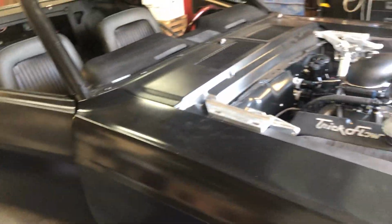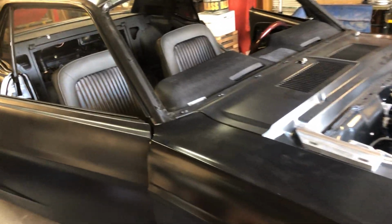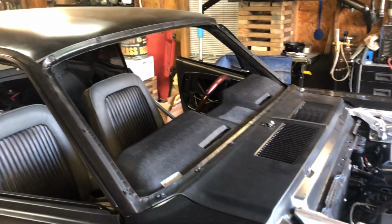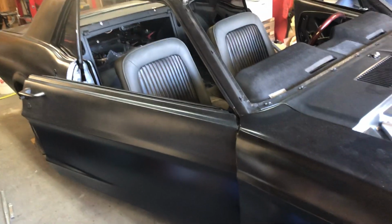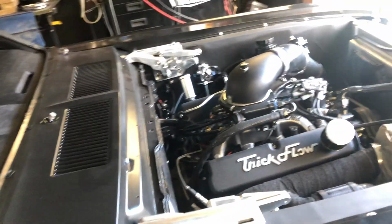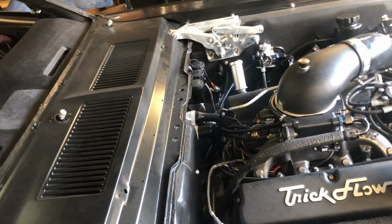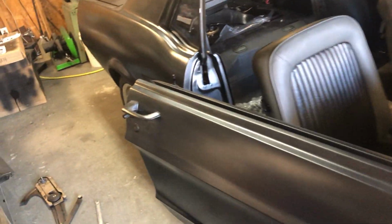However, my 4-puck clutch that's in here is a no-go. It is really shaky trying to ease off the clutch. And as low as this thing is, leaving from my driveway to the road is a kind of a dip. So it was quite fun trying to ease it down, shaking it apart, because the motor mounts on this setup are stiff as can be. All the suspension, stiff as can be. So the whole car wants to shake like crazy when you're trying to ease out the clutch.